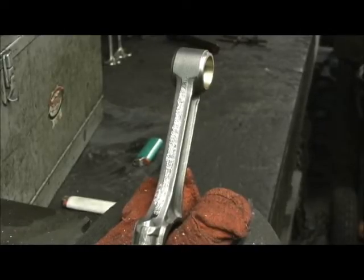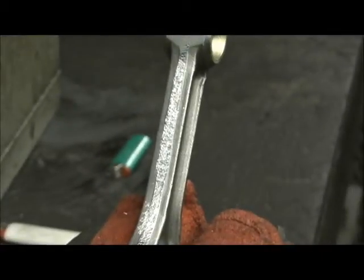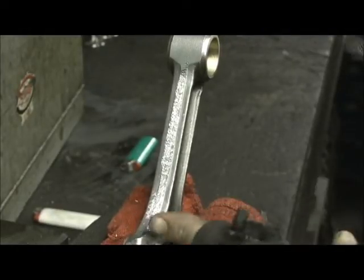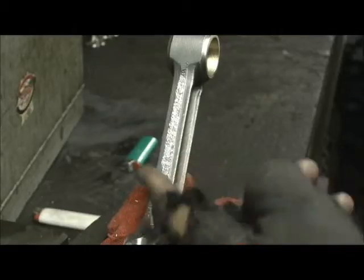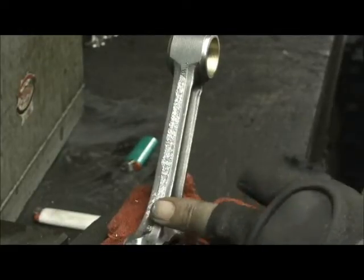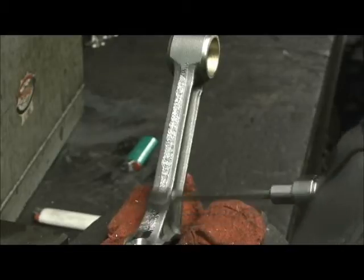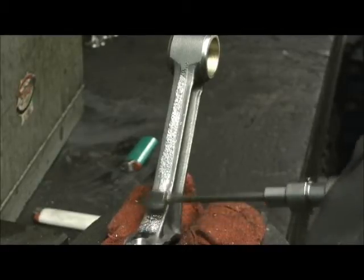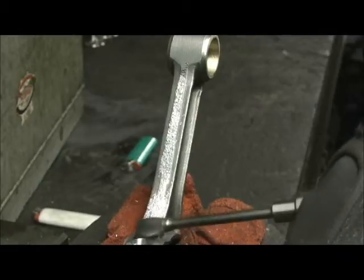Notice how I've stayed right there on top of that beam. I have not gone on either side. The first thing I've got to do is pull that beam down a little bit, not a whole lot, and then try to get a roll off of it. The area that the connecting rod snaps is about right here to right here. This is what's called vector loading from this area to here. You never see them snap in the middle — it's always right here because that's the transfer or vector loading of power from reciprocating to rotating masses. As soon as I got it level, I went from side to side to blend it in.